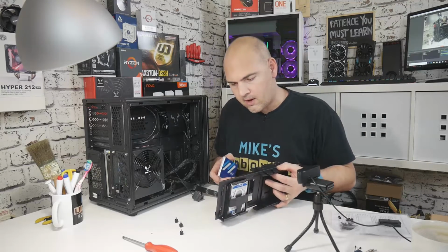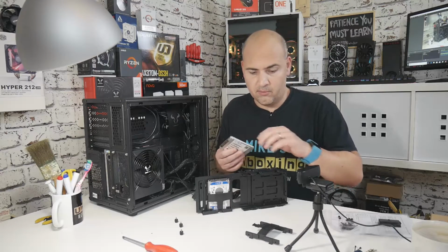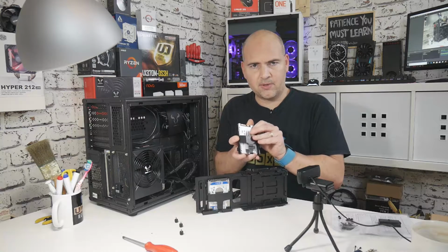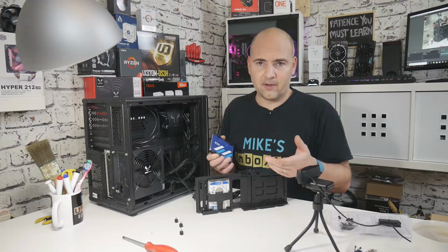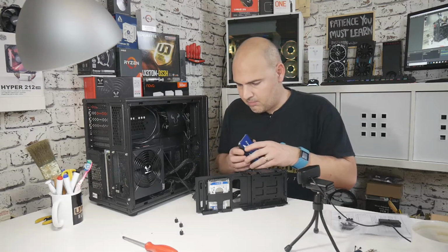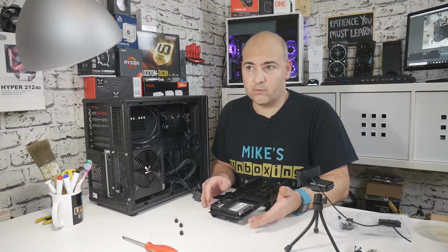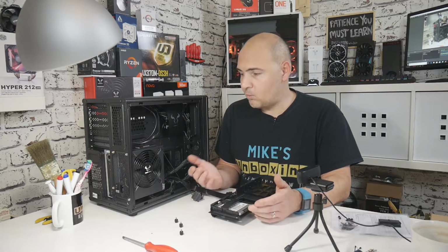And also, I would like to highlight to you all the dangers of vaping and computing. Now, my son George's PC was properly disgusting, because he vapes like crazy in his bedroom, and almost every component in that computer was affected. This is an S340 case, which has some pretty decent filtration and not a lot of airflow, so how the hell the vape juice gets inside the PC, I don't know. Maybe he's blowing smoke rings into the damn thing. But it was literally wet inside the PC with vape residue, which I guess a lot of people probably don't think about. But vape is water vapor, so if you vape in an enclosed room and you've got fans in a PC, it's going to pull it all in, and because it has a moisture content, it will kill components.